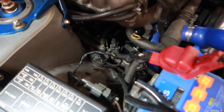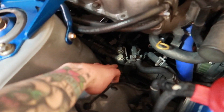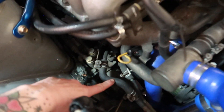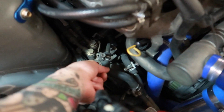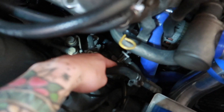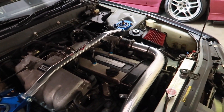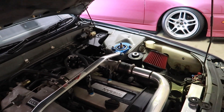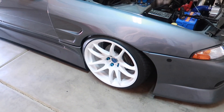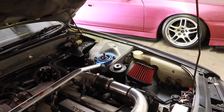I'll show you everything in detail to the best of my abilities. In a nutshell, we'll take out all the bolts holding the bracket holding the HICAS system, take off the hose to the HICAS pump, and then loop it down to the cooling return line. While unbolting lines and hoses, we will lose quite a bit of power steering fluid, so at the end we'll refill the reservoir and bleed out all the bubbles. With the Skyline in the air, we'll go lock to lock, ensuring all the bubbles are removed and the whining from the pump goes away.